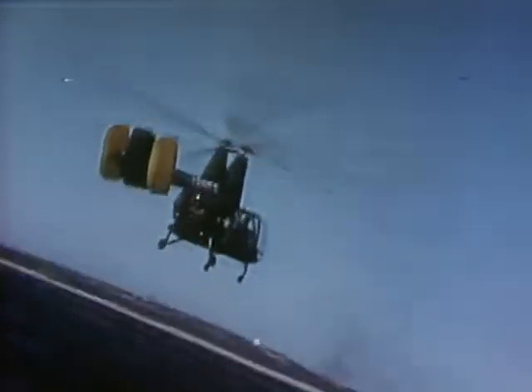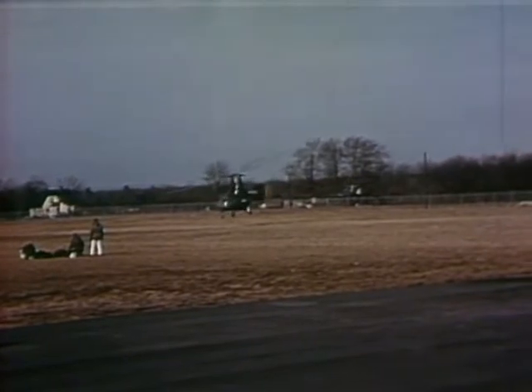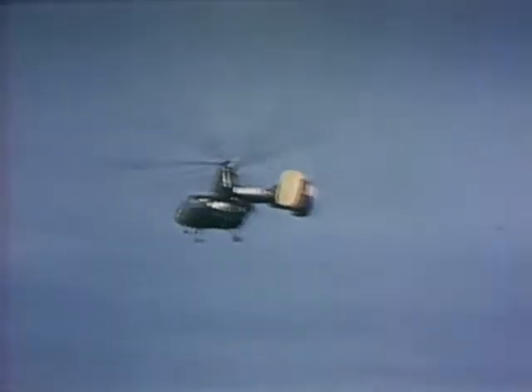But in the air, it's the pilot who acquires confidence and the joy of flight — a confidence born of experience, a thrill that comes when you have a responsive machine at your fingertips. The controls become extensions of your arms and legs. This feeling of oneness is possible because the servo flaps control the rotor blades in a natural fashion. No muscle or hydraulic power is needed. Deflection of the servo flap produces a force which twists the rotor blade. This change in angle of attack effects an increase or decrease in lift — it's like power steering without the mechanical complications.